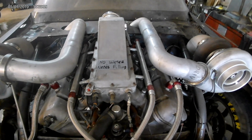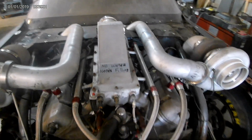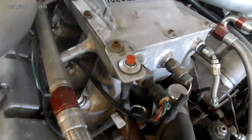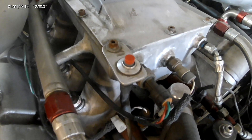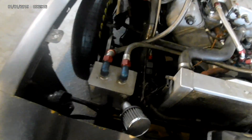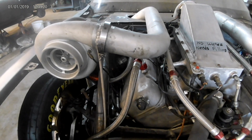I can go over everything I did again. The only thing I didn't add was water — most of the water around here is full of iron. That's the bump button for adjusting the valve; Dave came up with that, real good idea. All these sensors are for the computer. That's the new puke tank I put in. Used to have a vacuum pump, but we got rid of that and added a Moroso external single-stage oil pump.